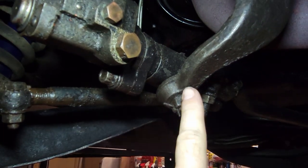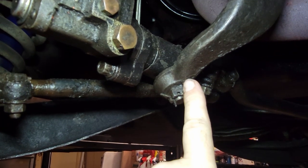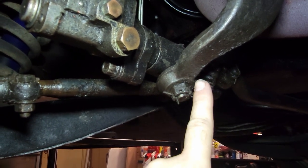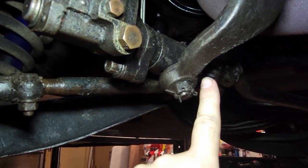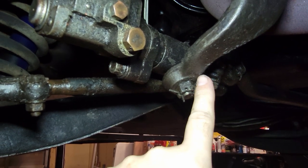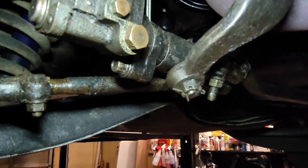This was moving, I don't know if this is an exaggeration, it's hard to tell, but he would turn the steering wheel and it would move to here before the rod would move. I mean, it was a good half an, nah, maybe not quite half an inch, maybe like 3/8 of an inch this way. And then he'd turn it the other way and the whole wheel would go, and then it would center, and then it would go to here before anything started moving.